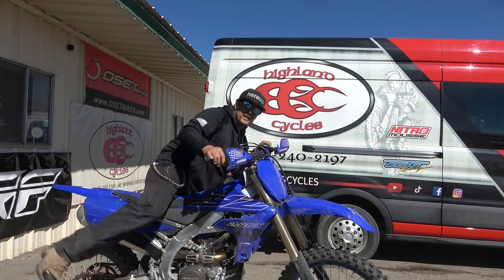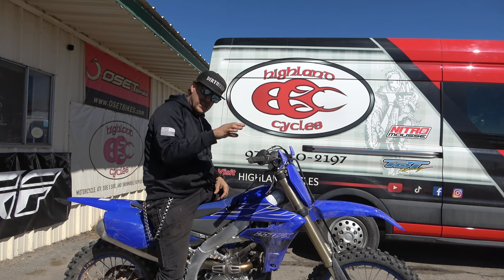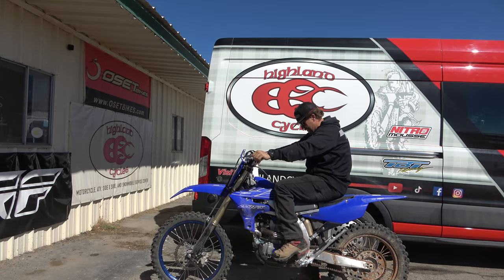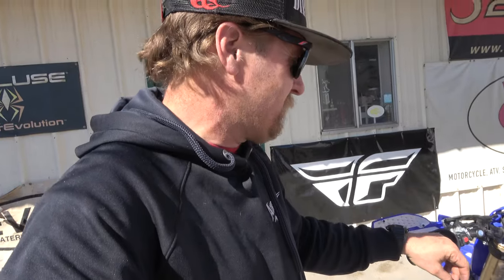Now I'm going to kick it into gear. What you want to feel is a little bit of drag when it goes into gear, but you don't want it to stall. We're in gear, pulling just a little bit — not much. Works perfect. It's pretty simple; it's not really very hard to do, especially on these bikes. The hydraulic operator bikes — the Austrian bikes — you've got to bleed the clutch and all that stuff, but these ones are super simple. The only problem is that if you have to make any adjustments, you've got to take the clutch cover back off.